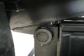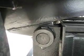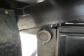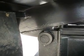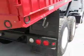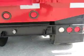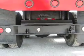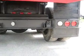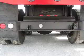Heavy-duty rear hinge assembly with absolutely no play in it. It's been rebushed on the hinge side, and the grain body from the hinges on up is entirely brand new. And again, the side panels are made out of 409 stainless material. It will never rust. Heavy-duty rear bumper assembly that's adequate for putting a hitch plate on it if you so desire.